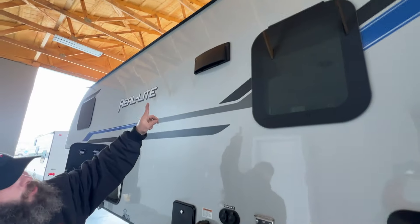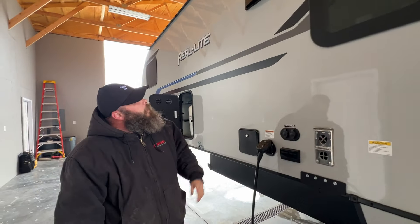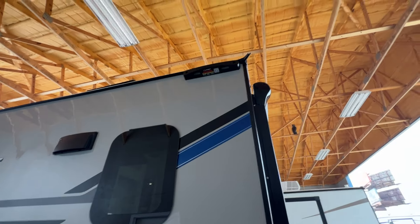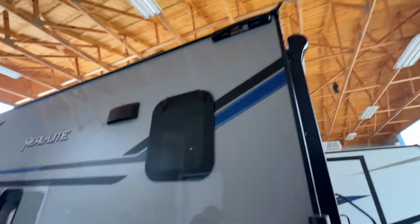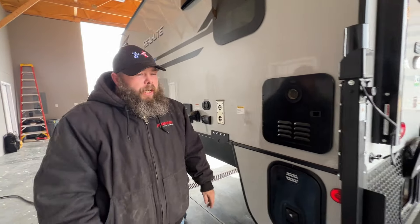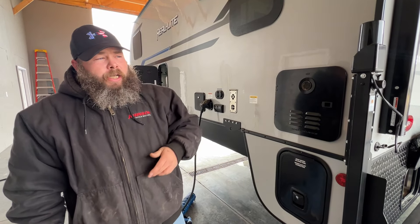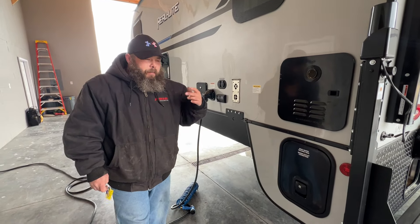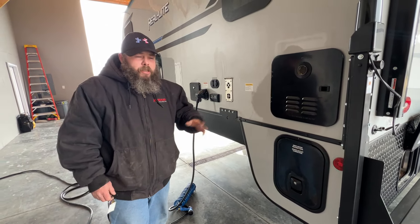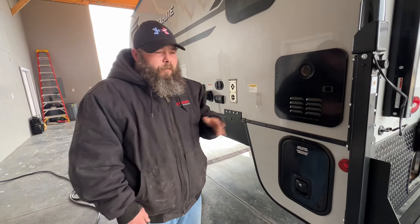Up top is where your vent is for the stove. The inside flap does have to be popped open when you are using the vent on the stove, and usually you've got to secure it closed — you would definitely need a ladder for that. You also have an aftermarket telescope ladder with two hooks where it hooks to the top and telescopes down so you can get up and inspect the roof. It is recommended you inspect your roof every 90 to 120 days. Make sure that lap seal hasn't created any air bubbles or started cracking. When that happens, you want to clean those areas and then put the lap sealant down.